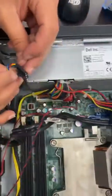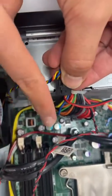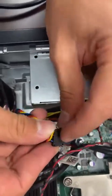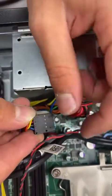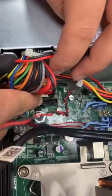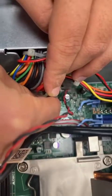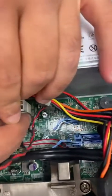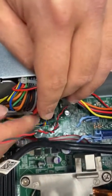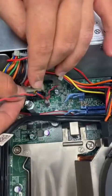The fan is now stable and won't fall. Take the cable and make sure you're inserting it with the switch facing the correct side — one side is clean, the other side has the switch, and the connector hole has a matching space for it, just like a puzzle. Push it down and you'll hear and feel the click. If you try to pull it back up, it should stay — that's a stable connection.